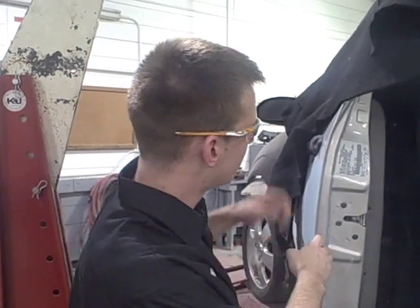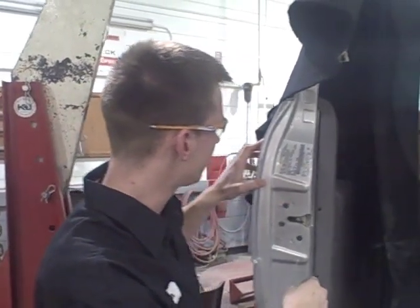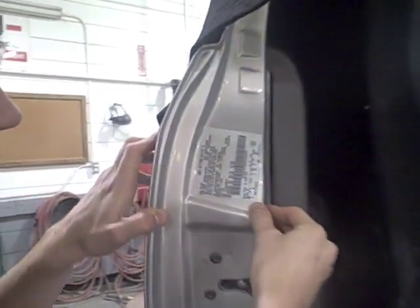A lot of your cars, the paint code will be in various places — on your doors, in the trunk, underneath the spare tire, or in your glove box. Today for the Ford Focus it's real easy to find; they're normally on the door. You just look through the sticker and right here it says 'exterior paint' and the code is TS.